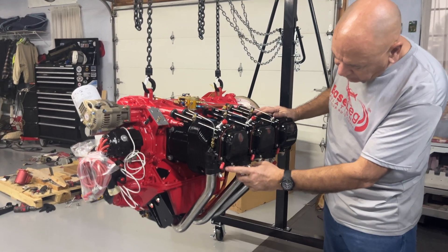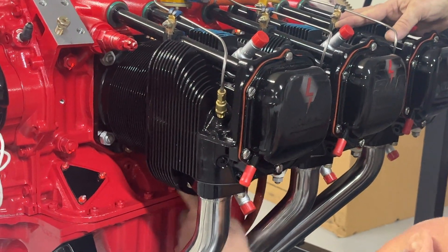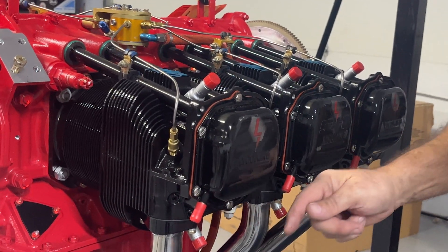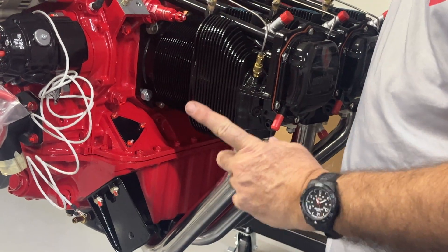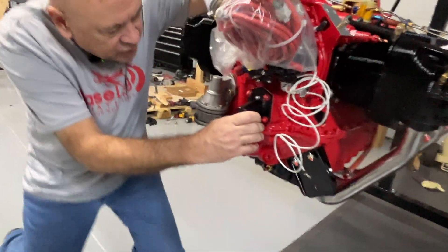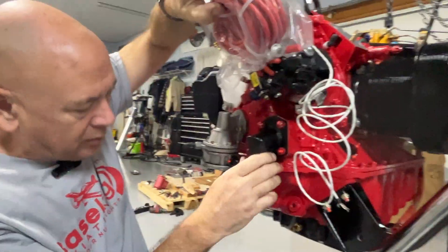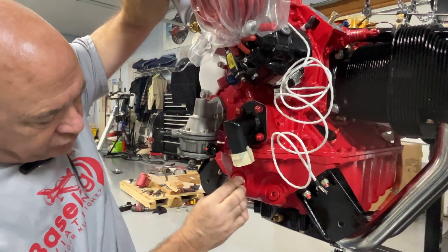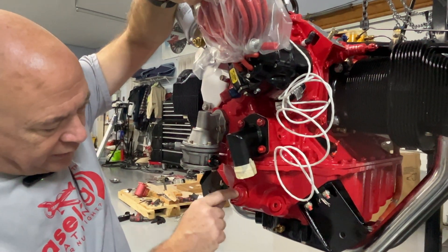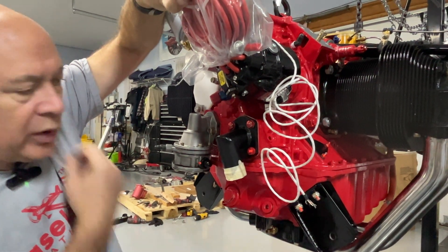If you look here on the cylinders, they have drain-back tubes on them. Normally you'll see drain-back tubes from these cylinders right underneath the crankcase on the engines most of you are used to using in your airplane. That doesn't work here. With this tipped at an angle, we want all this oil to drain back to the sump. So it's basically an aerobatic setup. Where your propeller governor would go, we're actually going to collect oil here back to the oil tank. The oil tank will be remote-mounted — just dry sump. And where your oil filter screen is, there's an adapter coming from Lycoming; that will feed oil to the oil pump. So we plug it internally there, just like an aerobatic engine, and we'll use this fitting to get more oil to and from the oil tank from the sump.